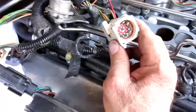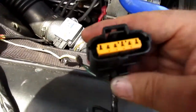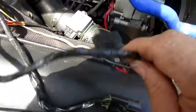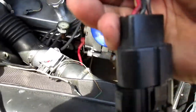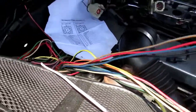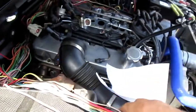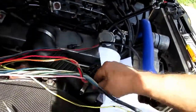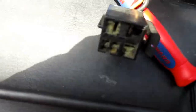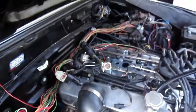It's just less wires hanging around your engine. Over here, I have to keep this plug — it's for the mass air meter; I pinned that in myself since this 88 didn't come with one. See how it'll be nice and clean — just four wires. This other plug gets removed; look how many wires are coming out of it. I've got more plugs to remove. Some have to stay, some don't — like this one with four wires: it does me no good at all, so more to come.